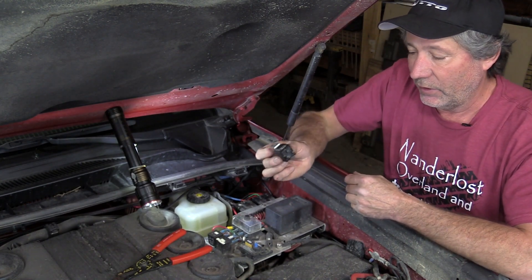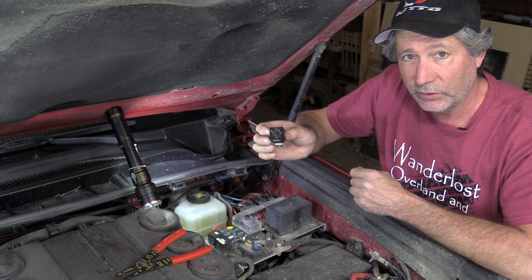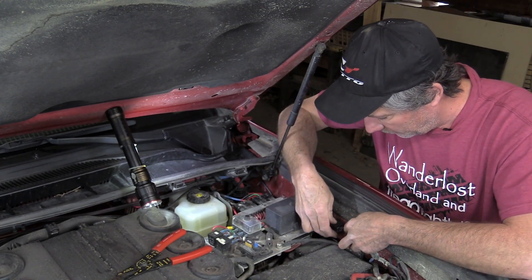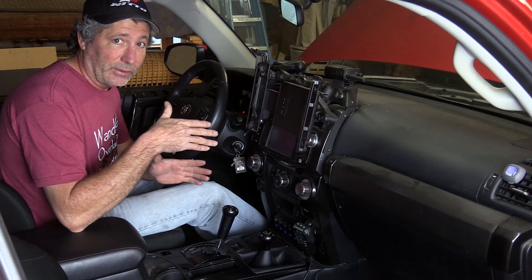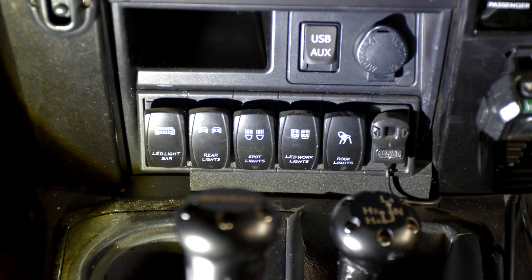If you don't want to go through the hassle of building one of these, you don't want to get an S-Pod, and you don't want to risk a fire running the wires behind your dash, this is your next best thing — a relay that you can buy just about anywhere, at the auto parts store. Something like this you can just mount out on the fender well or firewall, anywhere convenient. At the very end of this video and in the description, we provide a link to a video where I explain exactly how to wire up a relay. Tied directly into that fuse and relay panel we made for under the hood is a switch panel that we made — you'll find a link to that video in the description as well.